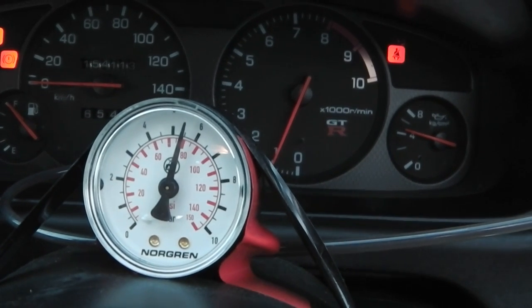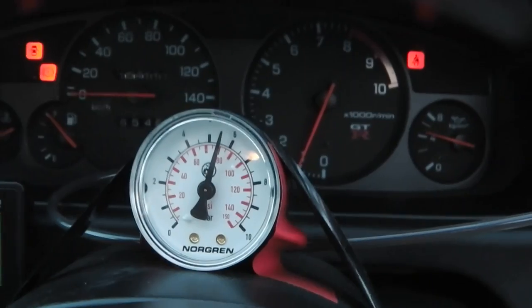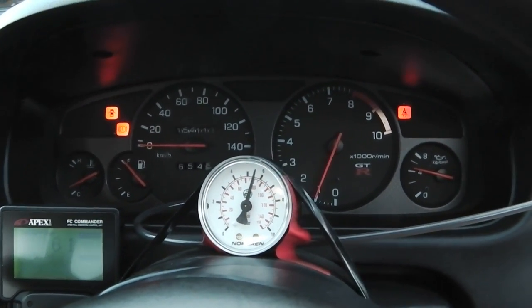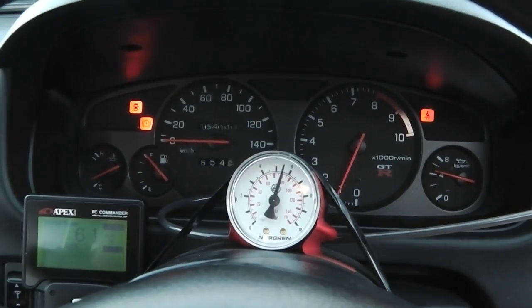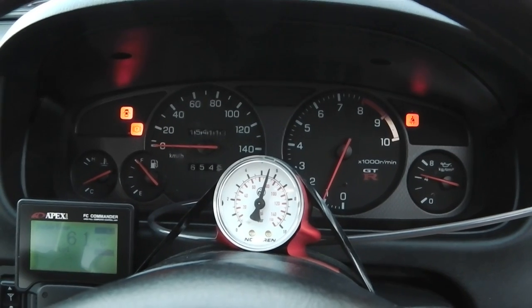You can see the HKS oil pump in this case has plenty of pressure — it's not quite cold but still 80 psi, whereas a standard factory pump will only be pushing about 30 psi at idle. The second function is that, as mentioned, when there's a pressure drop, the cylinder will kick in.